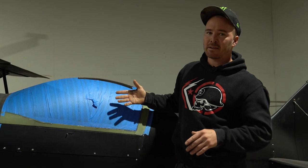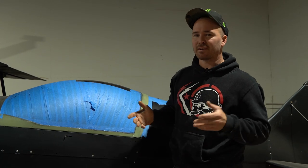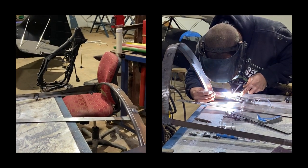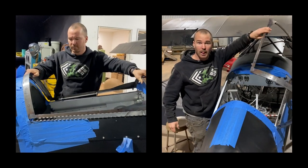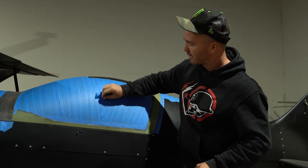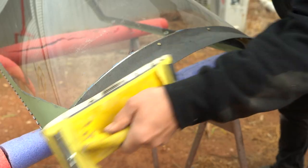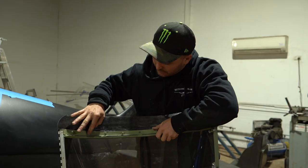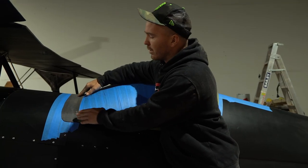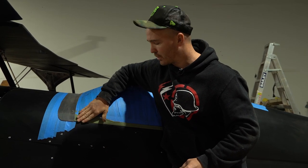Next bit of the puzzle was the canopy. With this plane everything's custom made, so you can't just go buy anything off the shelf — nothing's going to fit, you've got to make it from scratch. I made a 4130 really low-profile steel frame here, and then I've got some plexiglass — just covered in blue tape to protect it from scratches. The plexiglass is glued in, and I've got a little carbon strip around the front that I've got to trim up. Another few layers of carbon will fair everything in nicely and give it a bit more strength.